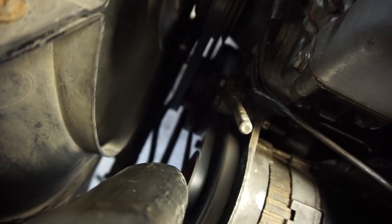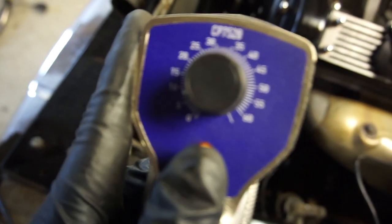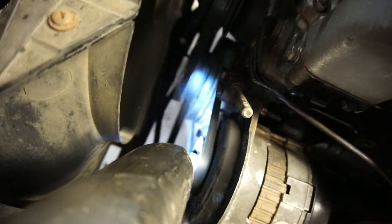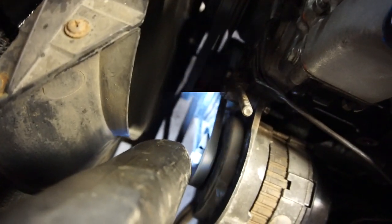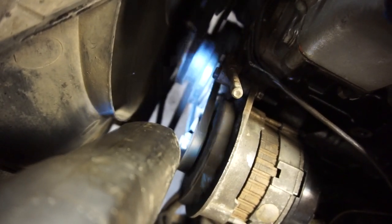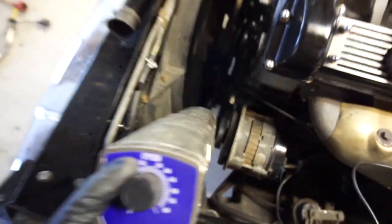That is the zero mark. And if I look at my timing light — that is set perfectly at eight degrees. So that's really good. I hope you guys can see on camera as I turn it, it goes back and forth. So I have it set to zero there, and as I lock my timing light, it goes down to zero. The good thing about this engine is that if you don't have a timing light where you can set the degrees — just one that's always at zero — you have timing marks down there and you can see it's set right at eight. So the timing is set perfectly.